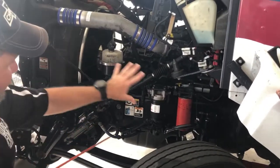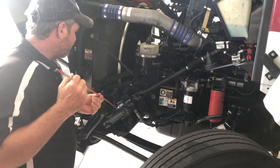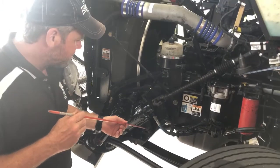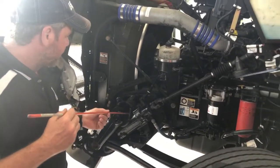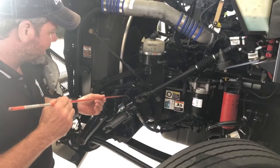Scanning for any leaks throughout the whole engine itself — anything possibly leaking, get it fixed. As I come down to my power steering box, I make sure the box is securely mounted with all its nuts and bolts in place, no nuts missing, none look loose by any rust trails or shavings. The power steering box is not cracked at all, and the seals and gasket are in place. None of the connections are leaking at all.